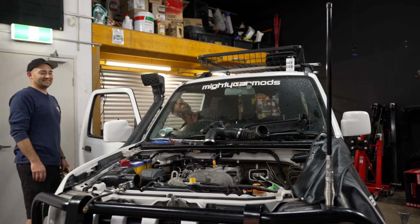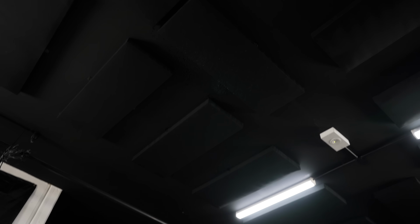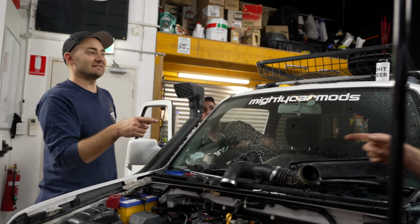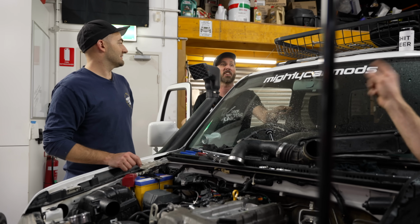Oh, wow. Well, it definitely had water in it. But hey, that was specific to one cylinder, did you notice? It was the back one. Was it the back one? The other spark plug was like greeny orange. Wait, was that number 4? Yeah, so that's the one that's screwed.